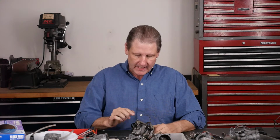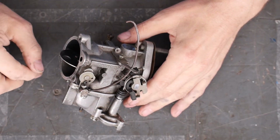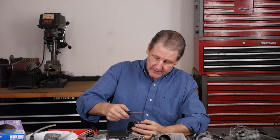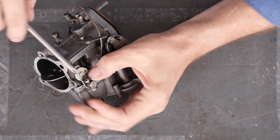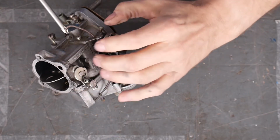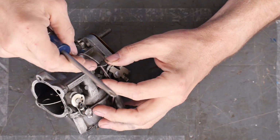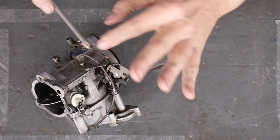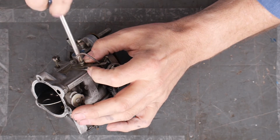All right, first thing, I built this custom goofy kind of choke thing here. And we're going to get that off because it's kind of sharp and pointy. The screw points up like I taught you in the tips and tricks video. Not too bad. Comes out. There it is. Oh, there's a little shoulder on there I forgot about. Then this was a little cup thing that used to cradle the steel shrouded choke cable, the factory cable. I've bent it flat. I'm going to bend it back curly because I'm going back to that style choke cable.